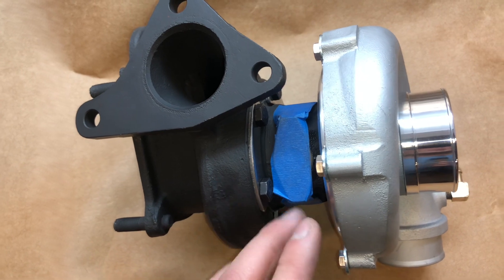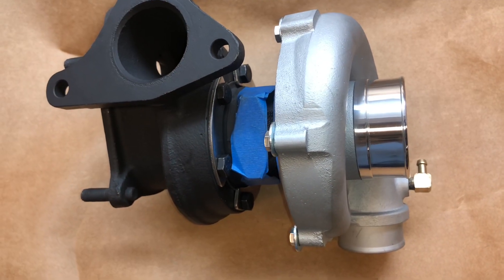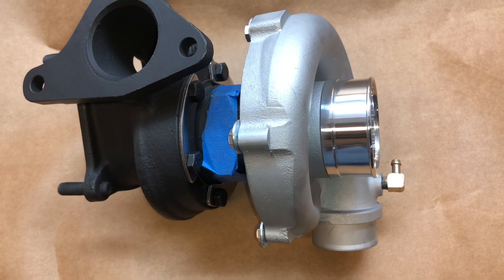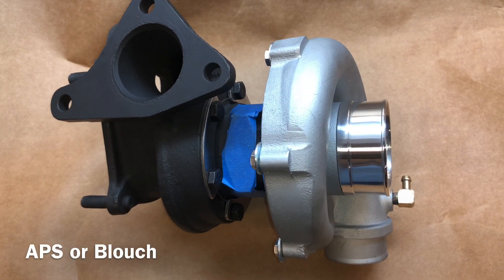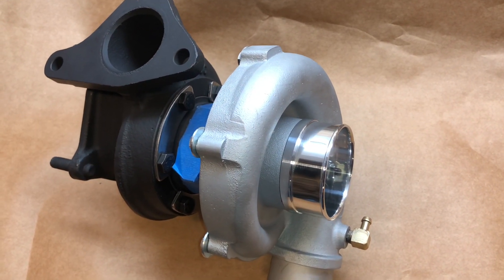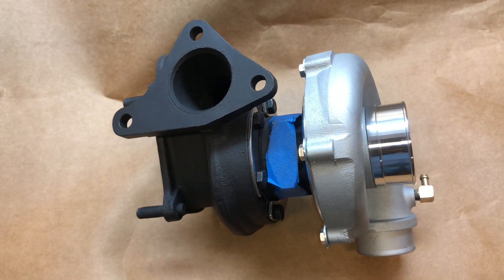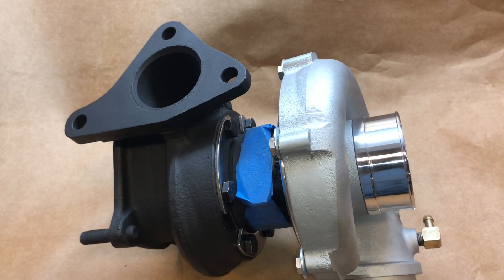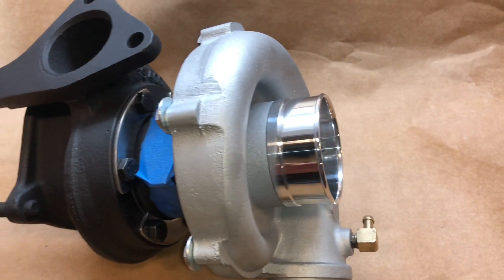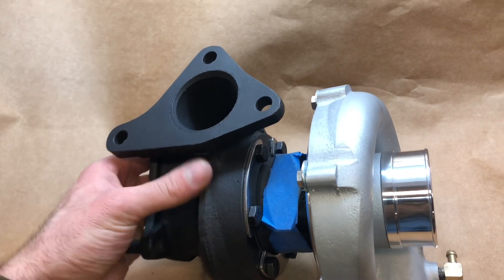The compressor housing is a special casting that APS has designed and made specifically for their turbos. If you do get a ball bearing turbo for the Subaru, it makes a lot of sense to get the APS version, because it's really hard to mount some of the Garrett ball bearing bolt-on turbos on Subarus due to the way they're designed. Usually the compressor housing will hit the transmission, and in some cases it's almost nearly impossible to do a bolt-on ball bearing turbo upgrade on some Subarus, especially the hatchback. So with this one, it's much more likely that you could do it — some of the other turbos make it a lot harder to bolt on.